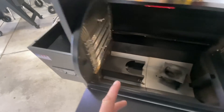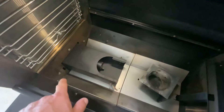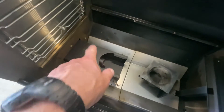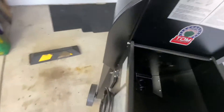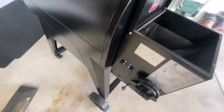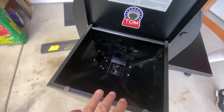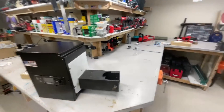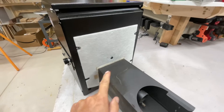So how do you get the controller off? This grill came with a manual so I know how to put it together. It's these screws right here — I said three but there are actually five. There's also one plug down in there that I have to pull out and unplug, then take those five screws out and I'll very easily be able to remove the controller. Down to the shop we'll go.